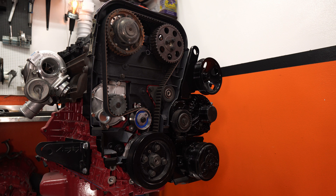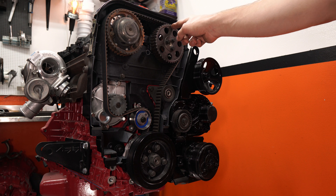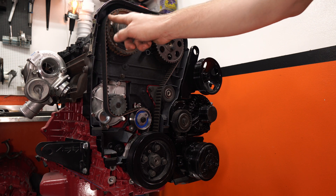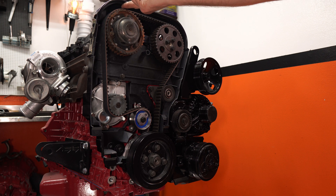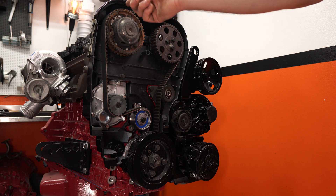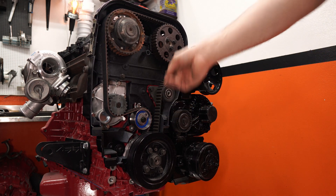Step number one: install the upper camshaft belt cover. Check. Turn the crankshaft clockwise until the markings on the crankshaft and camshaft pulley correspond. What they mean is the marking down here - there's a marking and a little indention right here, and the same on the exhaust - a small indention, very very small. These markings here should line up with the small markings in the cam belt cover. We're going to turn the engine clockwise until all these markings line up. That one lines up, this one lines up, and this one lines up.